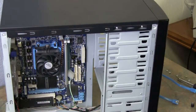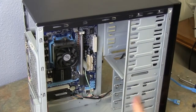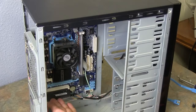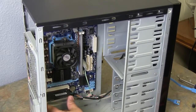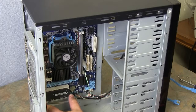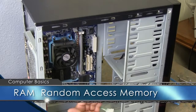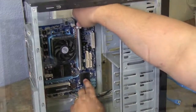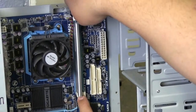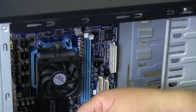Now to remove the system board, you can first remove each one of the components tied to it — cables, PCI connectors, or PCI Express. Whatever external add-on cards you have, you'd need to remove those. This is memory — it doesn't necessarily have to be removed when moving the motherboard, but you can. To remove memory, there's a tab on either side; pull both tabs out and the memory slides right out. There's your memory stick.